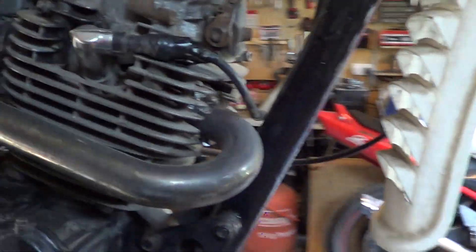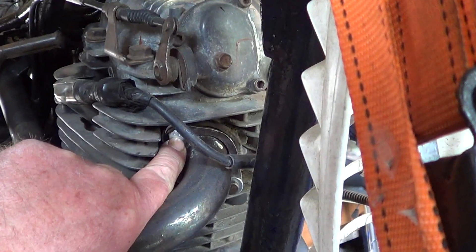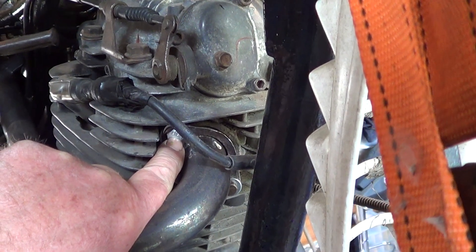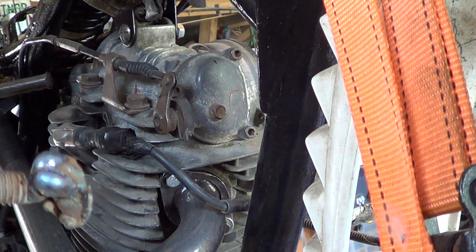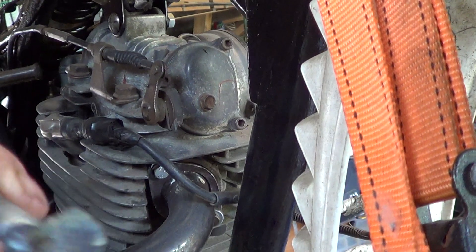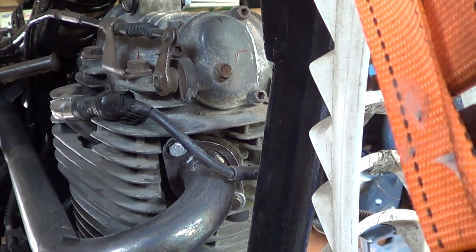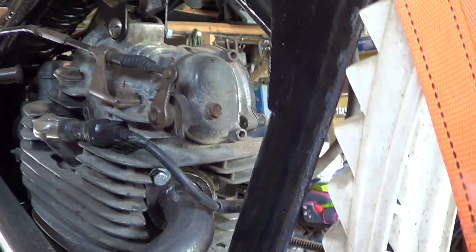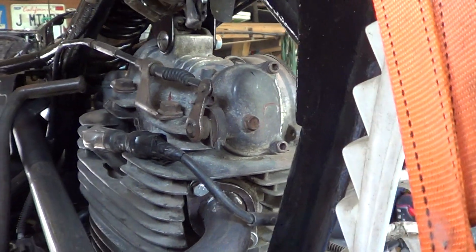All the exhausts were taken off - the stud was damaged in there. I did the old trick of welding a washer on the end of the stud and then fastening a bolt to it and trying to undo it, but it just wasn't enough and it kept ripping off. So I had to drill it out as best I could and then tap it, which I'm not a big fan of because normally things go south if I try things like that. But fortunately, done and dusted, sorted.